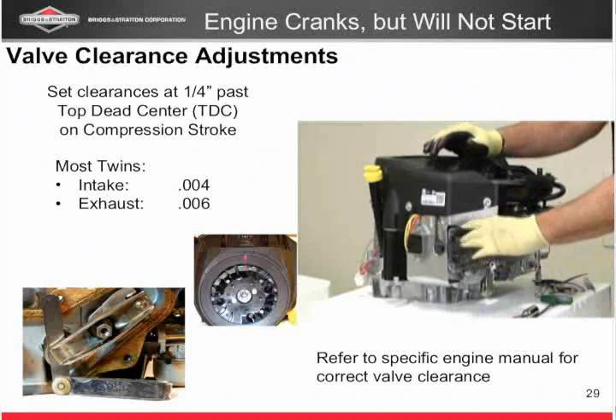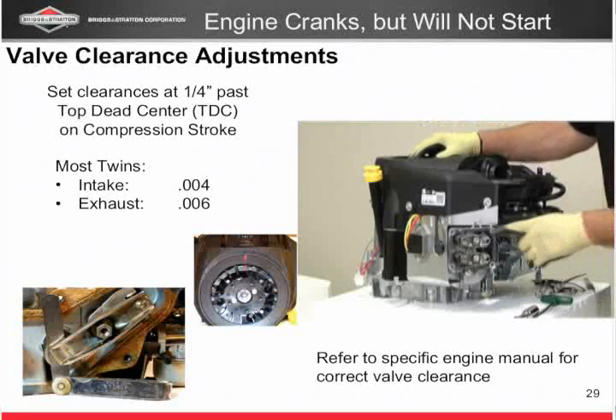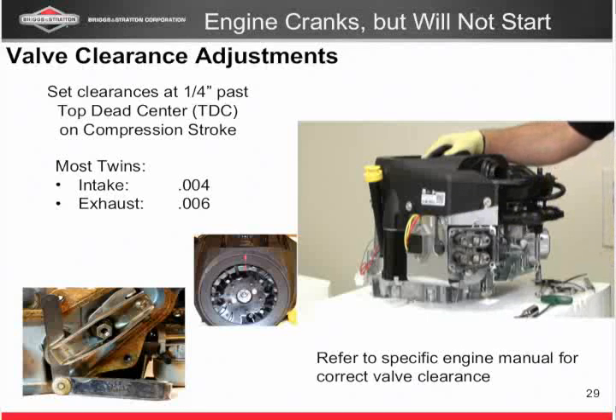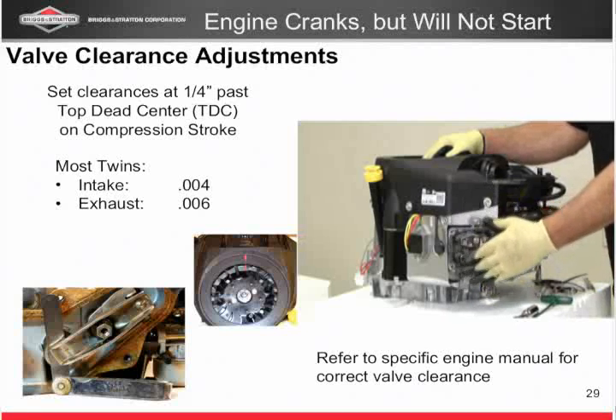You remove the valve cover to get at your valves. You can look at them and make sure the components are all assembled correctly. Another quick check I do is I'll actually cycle the engine — turn it over complete rounds — and watch my valve action, because all the valves going up and down, both intake and exhaust, should go up and down the same amount, about a half inch worth of travel. If you don't see that in both valves, you need to determine why. It could be an adjustment issue, a seat issue, or something caught underneath the valve seat inside the combustion chamber. We need to make sure those valves are working correctly, and in the stationary default position they're pretty much even too.